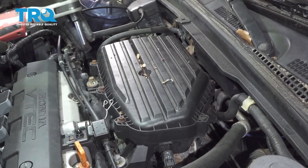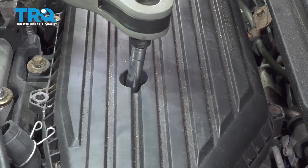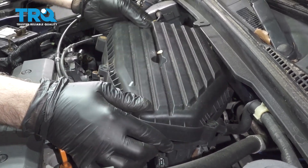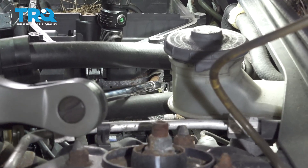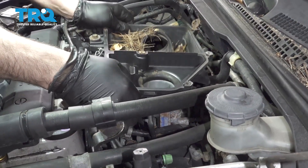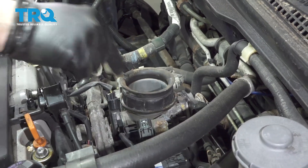Using an 8mm socket, go ahead and remove the upper cover. I'm going to remove this bolt. On the backside bottom of the airbox there is a clamp right here we want to go ahead and loosen — that's an 8 millimeter. Go ahead and pull this up and off of the throttle body. Remove your clamp and the rubber boot here.